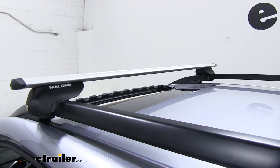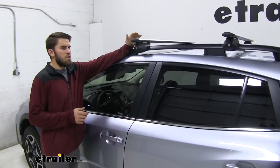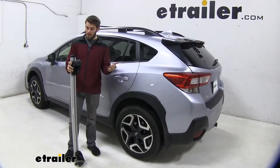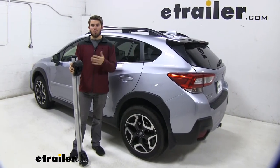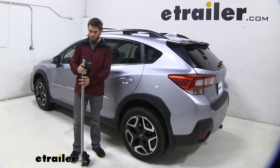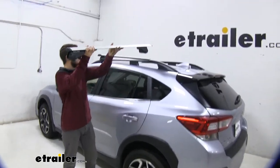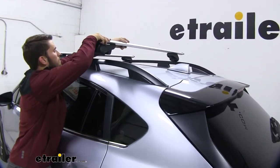You're going to be able to open the sunroof as you please. Now that we've gone over some of those features, let's show you guys how easy this is to get installed. It comes out of the box just like this — there's no assembly required. We just took the end caps off and we'll raise it over top of our Crosstrek and set it onto our side rails.